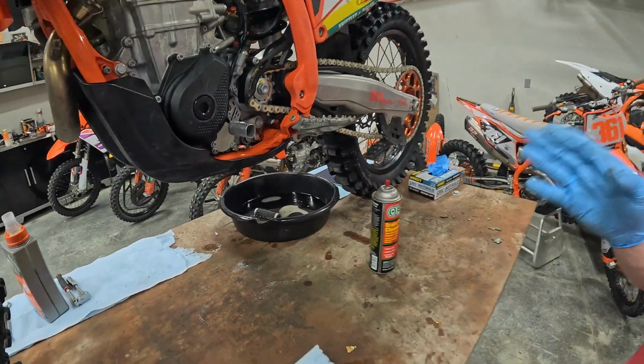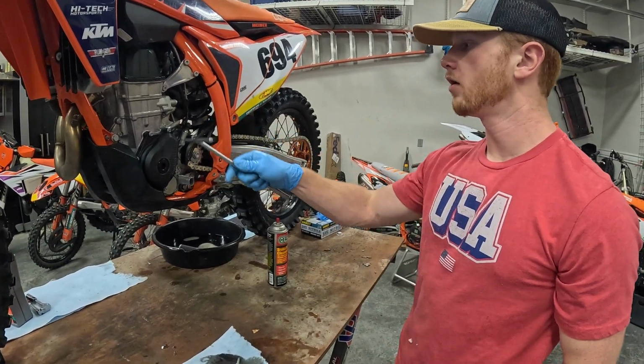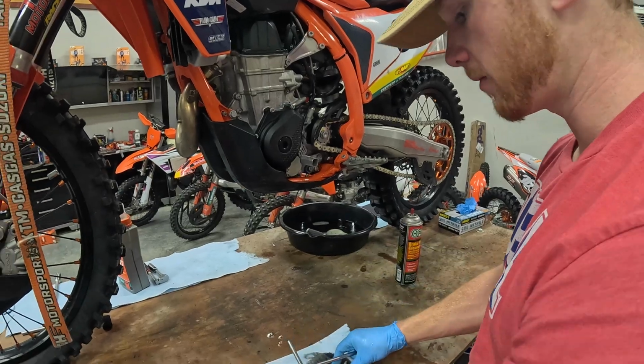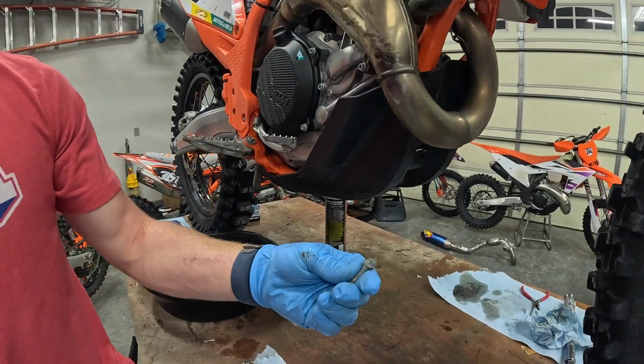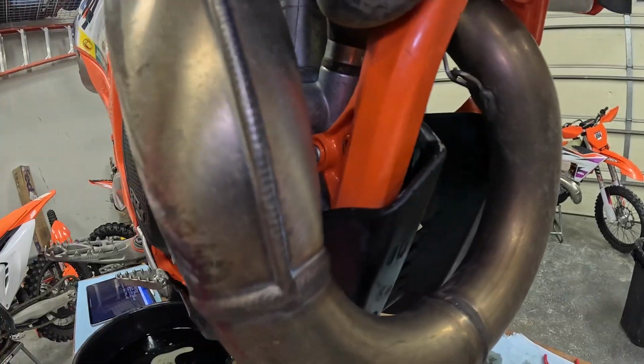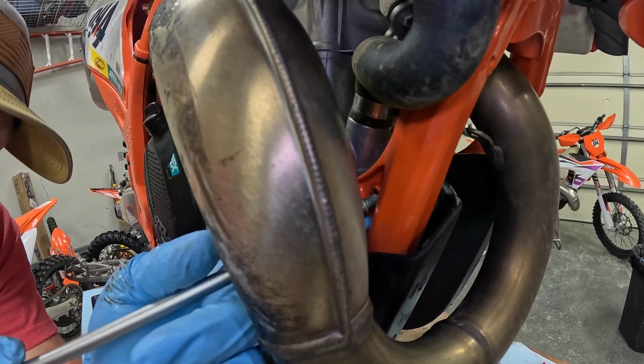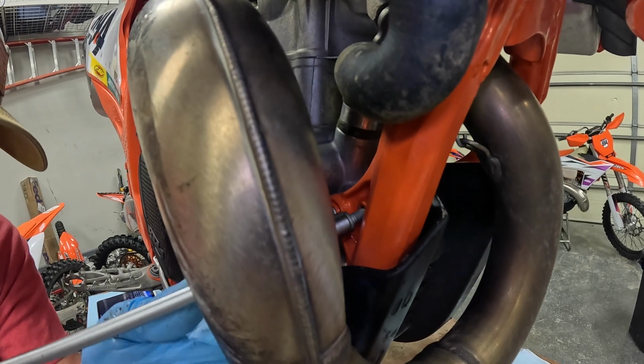And so I will say on these skid plates, you definitely want to make sure you get all 4 bolts in before you tighten any of them, because if you tighten this one, it throws that one out of alignment and it's a big pain. So again, long bolt goes into the top. At this point, you definitely don't want to drop the bolt into the skid plate. That's usually my signature move, and it's extremely irritating.